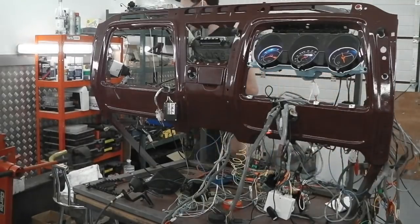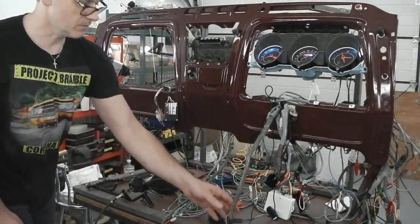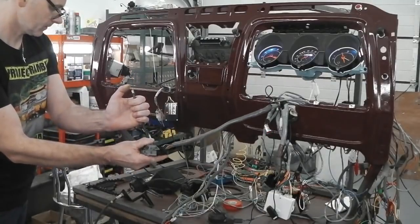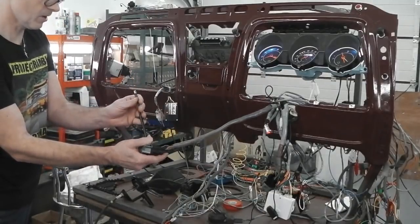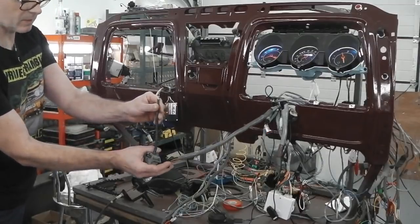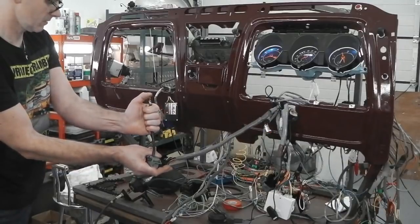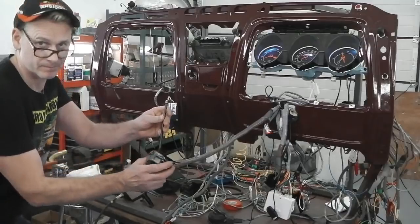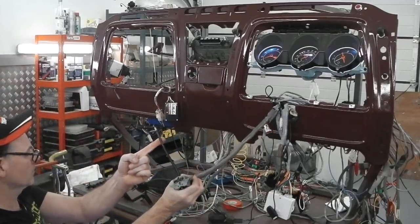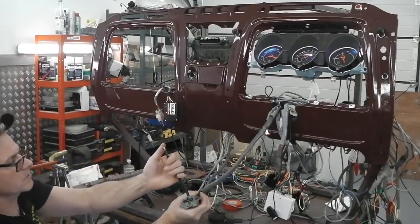Lock converter, torque lockup should be on. Yes, it is. Hopefully we can lock with a cruise now at 60. Boom! Straight into coast and resume. Coast. Sorry, that's completely killed. Relock the speed, sorry. Boom! Okay, and coast. Pull it up for coast. Off it goes, completely drops out. The torque converter's still locked up, that's great.